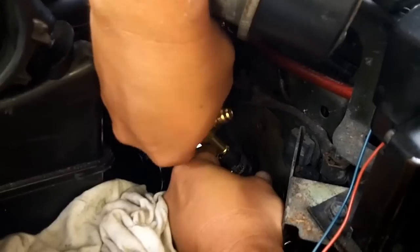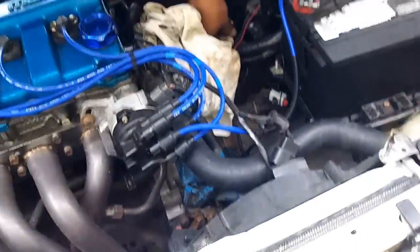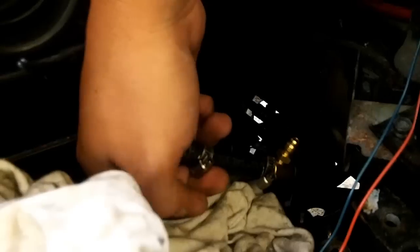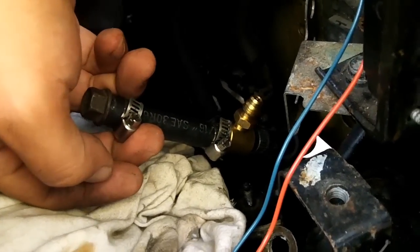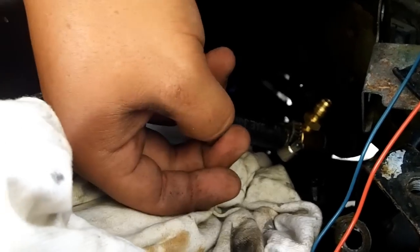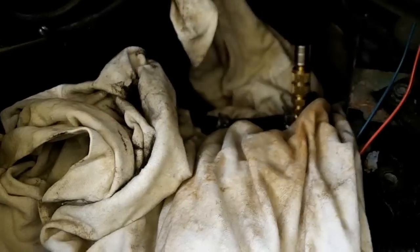So we're going to install this. There's your setup — you're going to basically clamp off this high pressure side, your supply side, so that it goes nowhere without the filter installed. This is going to test your max pressure without the filter. But if you can get max pressure without the fuel filter, it means your fuel filter is restricted or clogged. I'm just showing you this so that you can detect if you have a clogged fuel filter. Get your lead-off bottle — it doesn't have to be anything special. That's your Schrader valve; finger tight should be good enough. Stuff some rags down underneath of it.